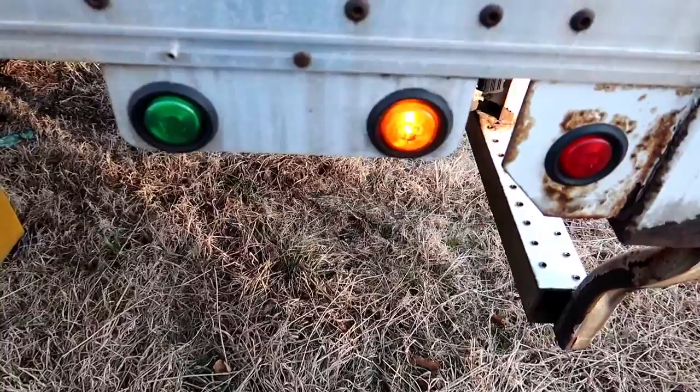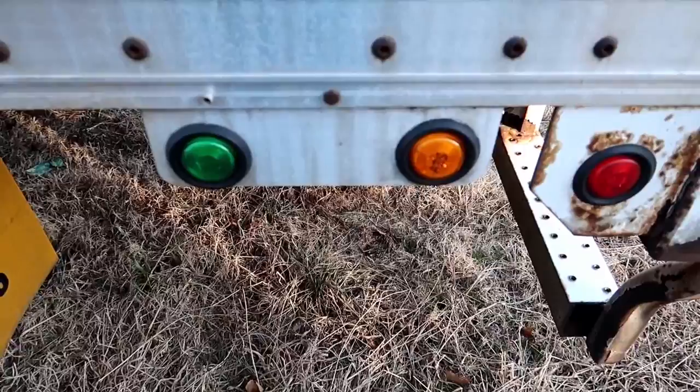All right, so I just did it three times, which should be stored codes. Before I clear anything, I usually check to see if there's any stored and see if there's any cleared. So here it is flashing. That's code 5. So I got a 5 stored and a 7 current.